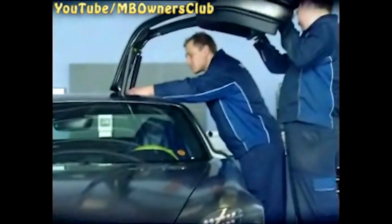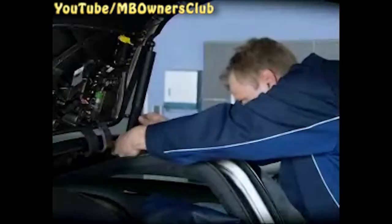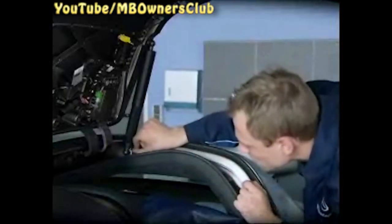Now to the door. The door lining is fastened with clips and can be easily removed. Then the gas-filled struts are next — get a colleague to help you. He holds the door for the removal. Every strut has two retaining clips at the upper and lower end. Take out the clips and with a little strength you can remove the gas-filled struts.